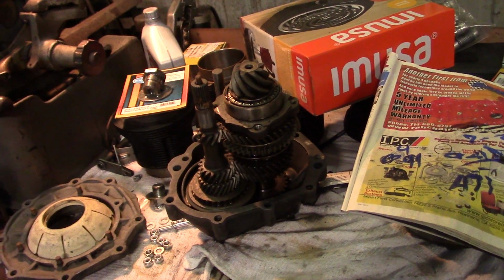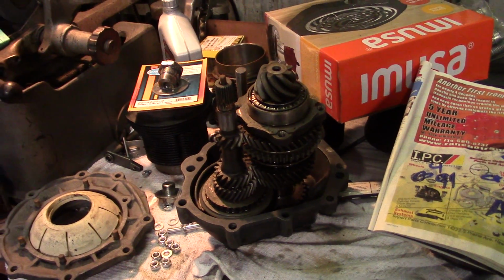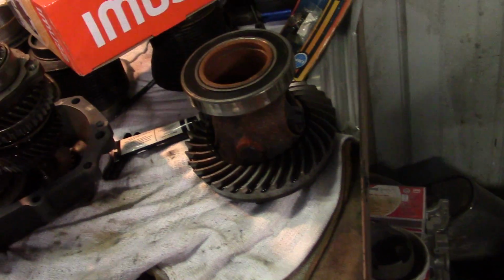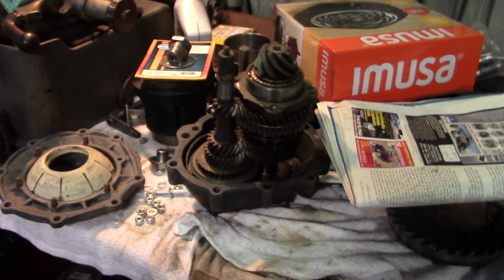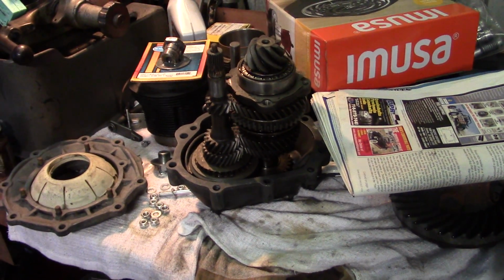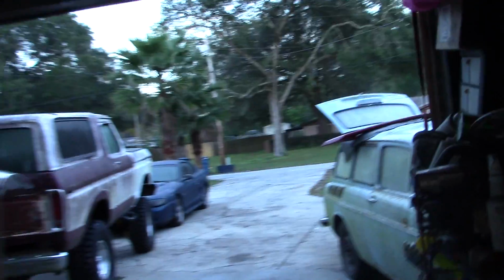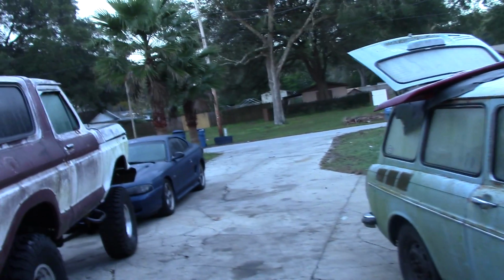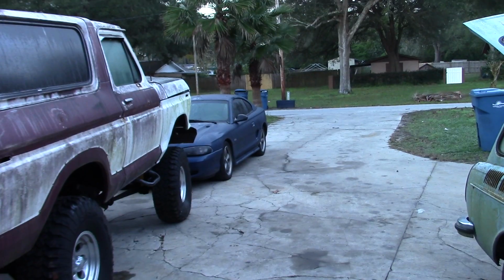the pinion up. We're going from swing axle to IRS, so I'm going to have to change the ring gear from this rusty diff over to the IRS diff, and we're going to put the 2110, I guess, in the blue car with this close box tranny. My son wants something fun to drive, and he likes driving that car, so we'll throw whatever we got together for him and let him have some fun.